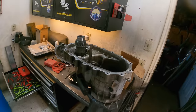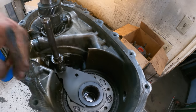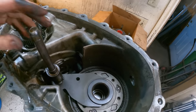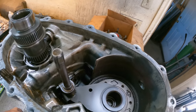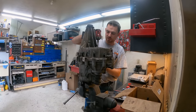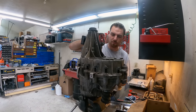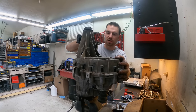Here is where things start getting a little nasty inside the transfer case — it's pretty baked, I dare say it's cooked. It's got a fine goo everywhere. I'll take it a little more apart and get the rest of this out. Because the other one was so bad, I'm pulling apart another parts case we had in the shed to see if we got good parts.